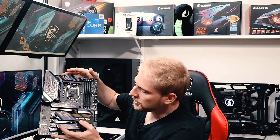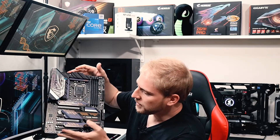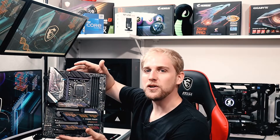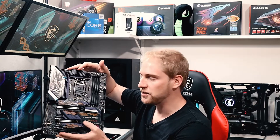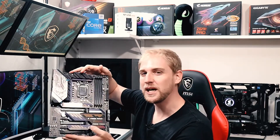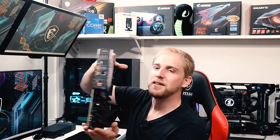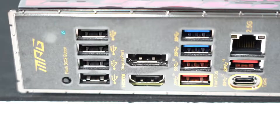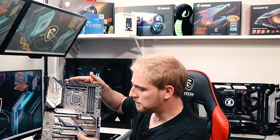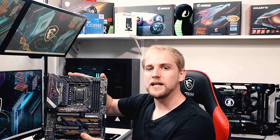Looking more towards the bottom, there is a bit of a design flaw for me. If you look at the CMOS battery, it's actually shaped inwards towards the heatsink, which means that if you do have a failed post, you're not going to be able to quickly get that out. You're actually going to have to remove this entire shield. If they'd rotated it up or moved it a little bit out, that might have been better. And there is no reset button so that you can't clear the CMOS — so a little bit of a design flaw in my opinion.